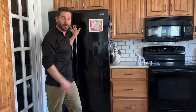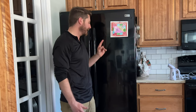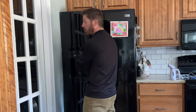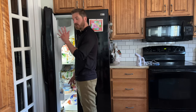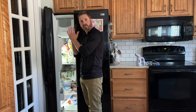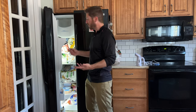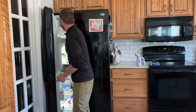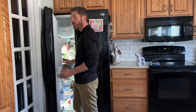In my case it's kind of simple, but it's also doing it sometimes when it's not so simple. The first reason why your freezer — or fridge, but usually it's a freezer in these types of setups — is making the noise is usually because of overstuffing. My freezer is kind of overstuffed and what's happening is the back panel plastic is hitting the fan. To stop that noise I'll just have to take out a few things, and as you hear, the noise has subsided.